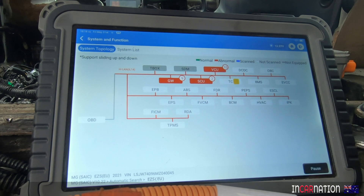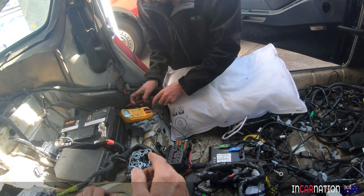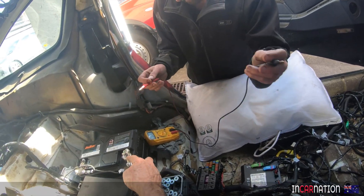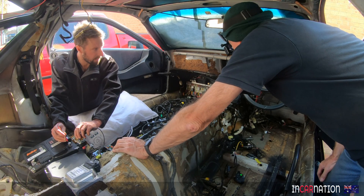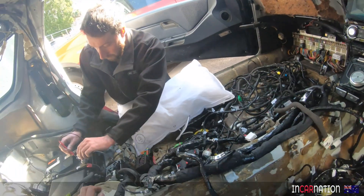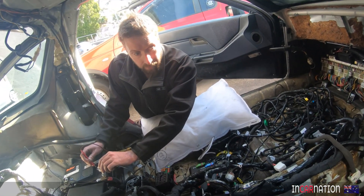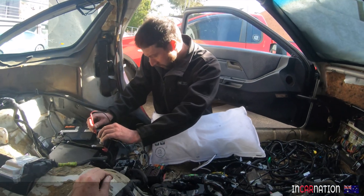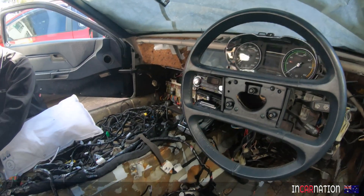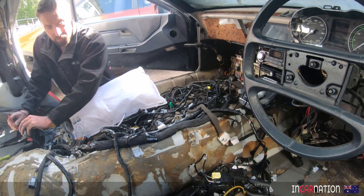Let's do a deep scan to see if we're ready to start adding back the high voltage stuff. It's on 10-amp setting there. If you just want to check between here and the terminal and just check we're not getting — we could hear something power on then. Something clicked. We've got about 2.9 to 3 amps. That's probably perfect — we don't have a dead short somewhere.